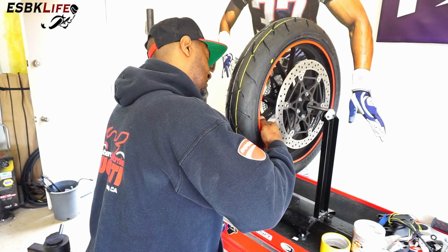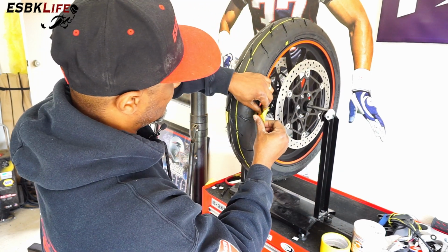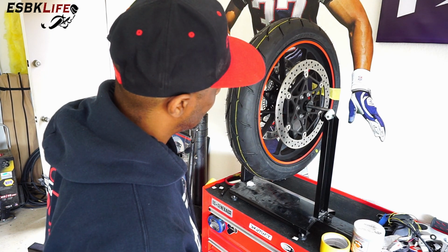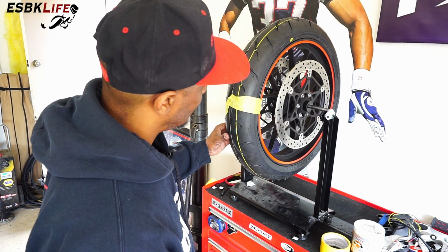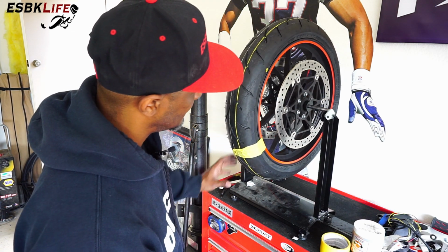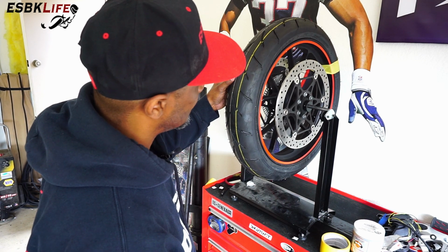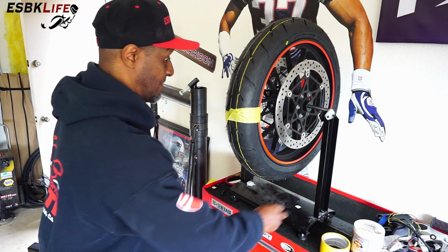Grab this other wheel weight, put this right in the middle. All right, so now we'll do this again. Come over here. It's over here. Not bad. It stays there. So it's falling here, so we still have some weight elsewhere. It's not quite right, but this is pretty good. So we're still falling there. So I'll just continue this process until it's balanced.